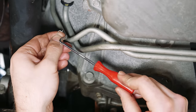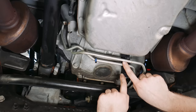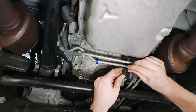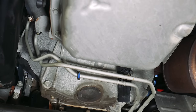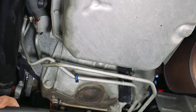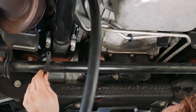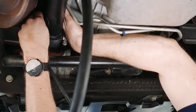Here's the retainer clip. If you get your pick tool under here, you can release these prongs and it'll pull out. Hold on to this — they usually don't sell these separately. There are retainer clips along your coolant lines for your transmission. Just pull the transmission line out. You see it clips together like that — use a flat-headed screwdriver or a pick tool to release it. With those clips released, have a catch pan ready. Just wiggle this back and forth; it'll take a little bit of effort. Now take a rubber hose and stick that over the return line so we can funnel it down into the catch pan. You can also take a three-eighths line and stick it into the transmission where you removed the coolant line, just to be safe.